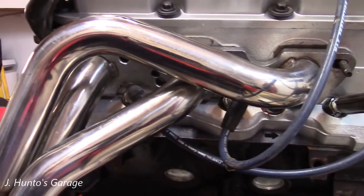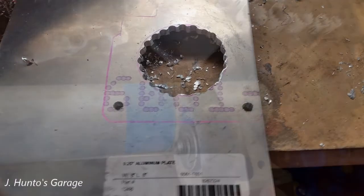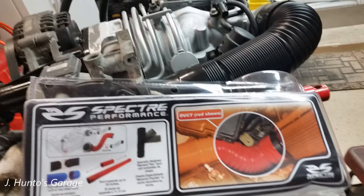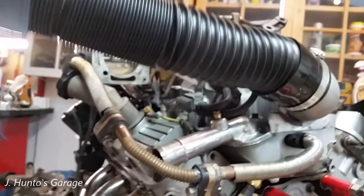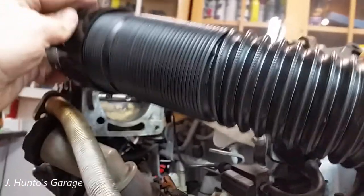With the goal of having most of the engine and intake system assembled before installing, I fabbed up a flange made from ¼-inch aluminum plate and 3-inch aluminum tubing to mount the throttle body to. That's my old friend JB Weld — this is basically a mock-up until I get a proper flange welded. I picked up some flexible tubing for the intake to make the connection between the inlet elbow and the throttle body flange, and even found a small bracket on the fuel rail to mount it to on the driver's side. This was the perfect location since it would be easy to connect the throttle cable without any modifications and would be a direct route towards the original air filter location.